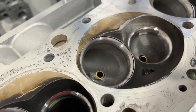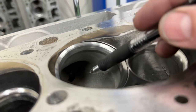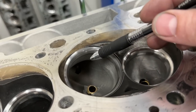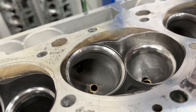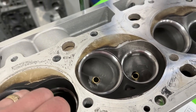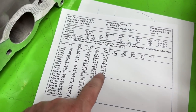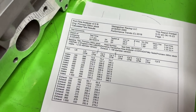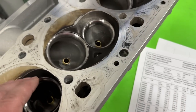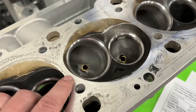The other bigger reason I'm showing you this: even though on camera you don't see it well, this is a very sharp angle right here. What I mean is the air comes and hits like a ridge — it's very sharp and hard. You might say why don't you just blend it out? I didn't blend any of the valve job. You could blend it and make it roll better and flow more, but the problem is I measure the throat — the distance from here to here — and if the throat's too large you will make a turd no matter what. Then you have very little angles to make the turn and you end up with really big peak flow but very low low-lift flow. I really care about flow down below. So I can't blend this in because the throat is about as big as it could be for this size of valve — you're stuck.